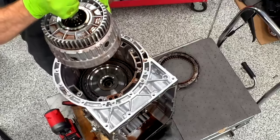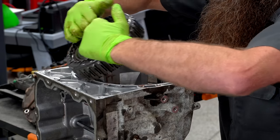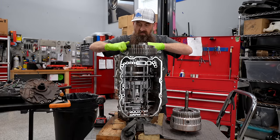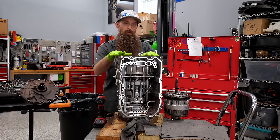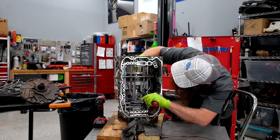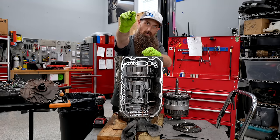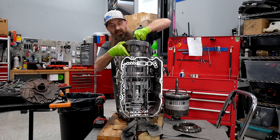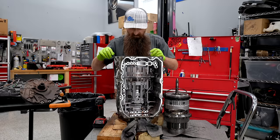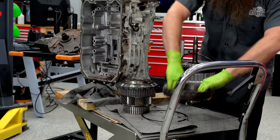Now I should be able to pull this whole drum out. That's one set, and then we have a lower drum — there's a clutch pack there with a drum. I think the easiest way to handle this is to finish pulling out the guts. Part of me wants to just puke them all out onto the table — that's not out of the question just yet. There are also some parts I'm likely not going to show, like this wavy washer right here, which is pretty cool. It's heavy. We've got a whole bunch of clutches in here. I'm trying to pull these out in their respective groups — these look much better than the first ones I pulled out.